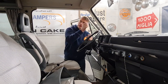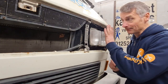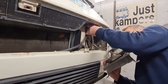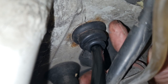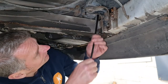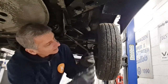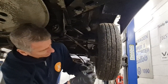From the other side where we've removed the grille, we can manipulate the cable into position and run it down to where we need to. The speedo cable got a little bit jammed up behind the headlamp, so the next thing is to pop the headlamp forward and then retrieve the cable. With the headlight pulled forward we can make sure that the weatherproof grommet is seated correctly, then grab the end of the cable and start pulling it through. Before going any further, we need to remove the electrical tape from the end — we don't want to be putting that through the hub.